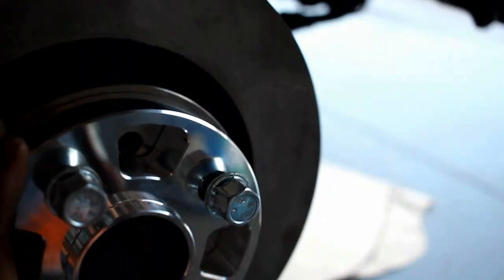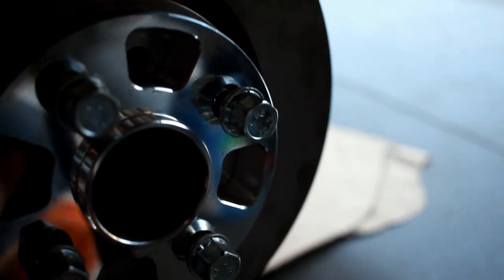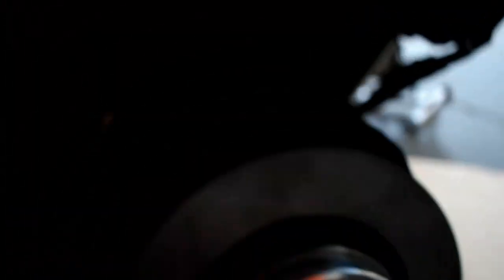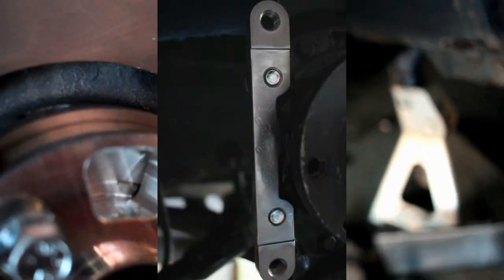So it's getting late tonight. I thought my spacers were good without having to hit anything, but after I pushed the rotor back it still hits on the inside of the spacer. That chamfer I showed you earlier — I'm going to have to get that milled down another millimeter or two. Also on this side I can only turn the rotor about halfway — right back here where that little bolt is on the top, I think the back of the rotor is hitting it, so I might have to cut that part out too.